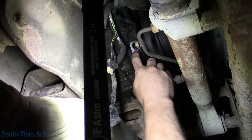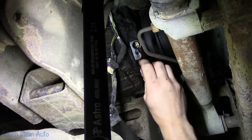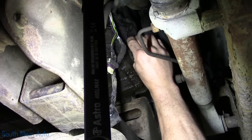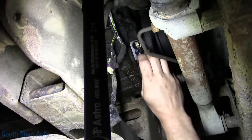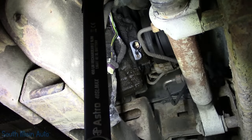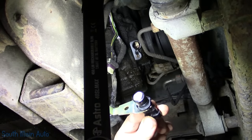I'll get a little dab of oil — I've already got the crank sensor out. Just put a little dab here to keep it from sticking. Put the crank sensor up here, make sure there's a flat spot sticking down. Push it in all the way, hold against the little fork there, pull it out, and we should have an indent. We should have a little indent from the reluctor wheel, which we do, and now we can measure that thickness.